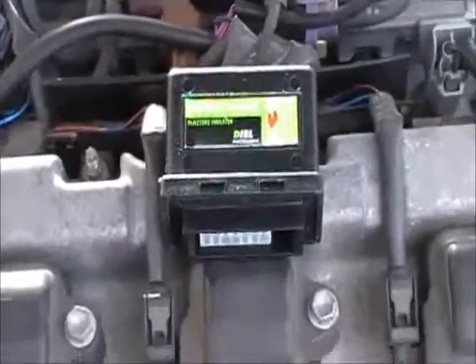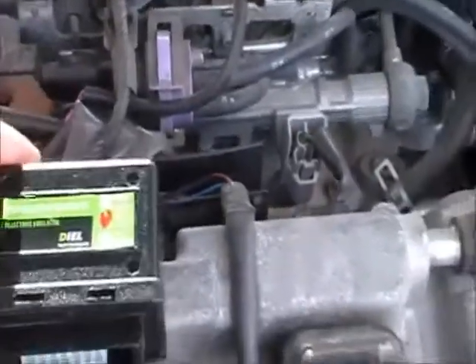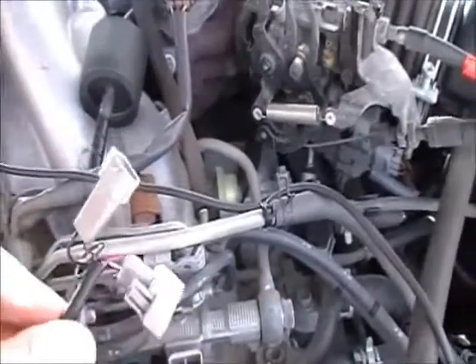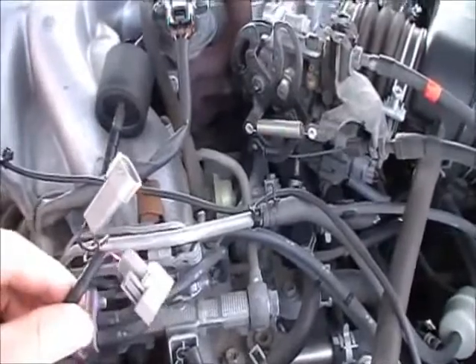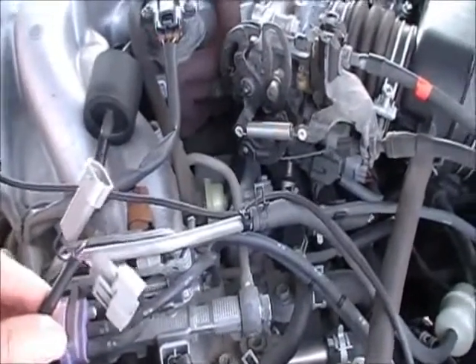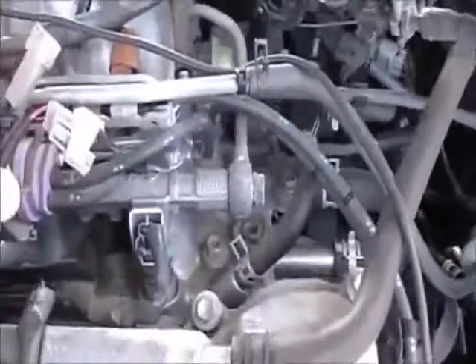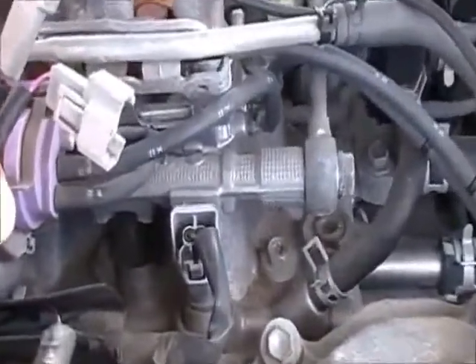They patch in with a cable from the bottom — this is one of the connectors on the cable. If you've got a four-cylinder there's four of them, six-cylinder there are six, eight-cylinder eight. For an eight-cylinder you get two four-cylinder cables, I believe. The way this connects in is it goes and patches in place of your original fuel injector cable.